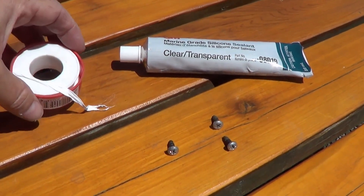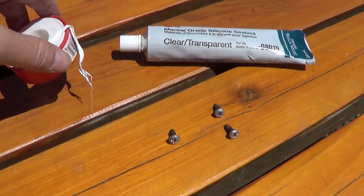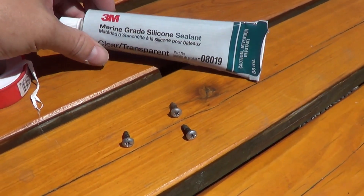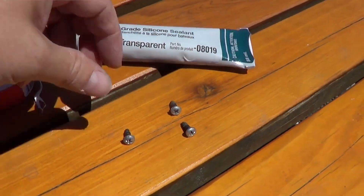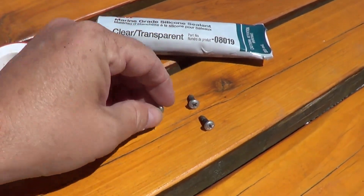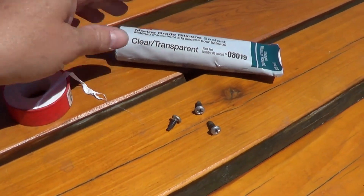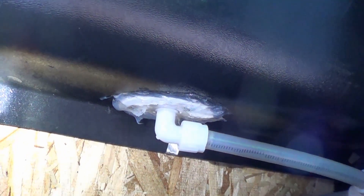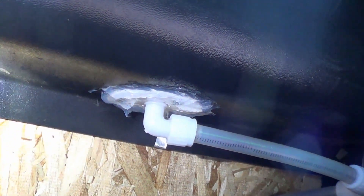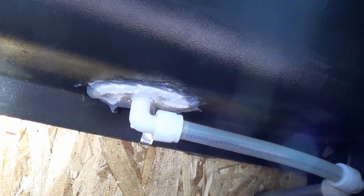Next I'm going to reinstall that nozzle. I've got some Teflon tape to wrap around the threads. Picked up some 3M marine grade silicone — clear silicone to remount it. Cleaned up the screws and all the old silicone off the tank. So we'll just put all that back together and we should be able to test it out. Okay, all siliconed in place, tightened up, ready to go. Let's give her a test.